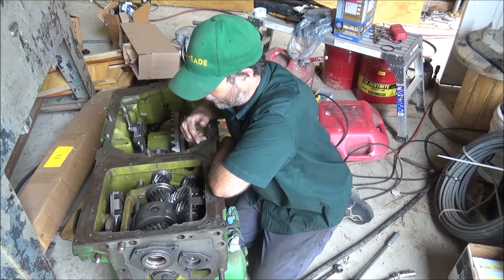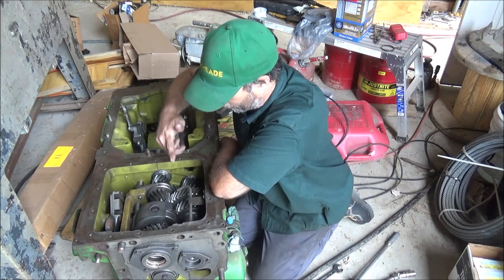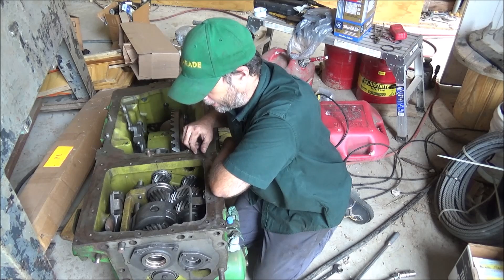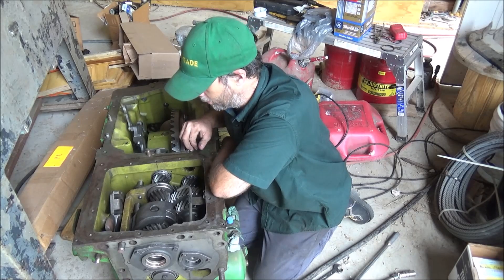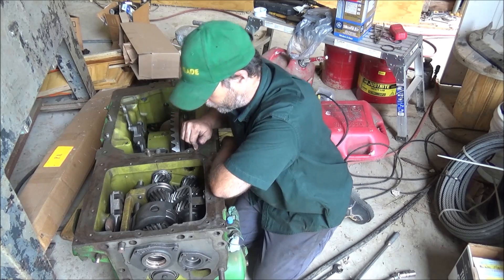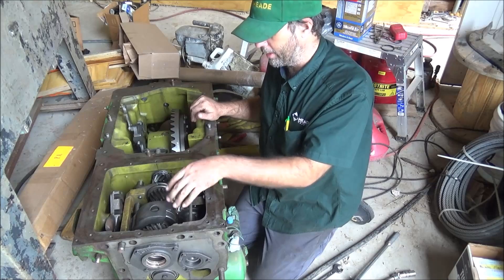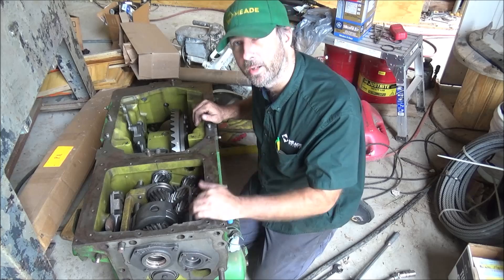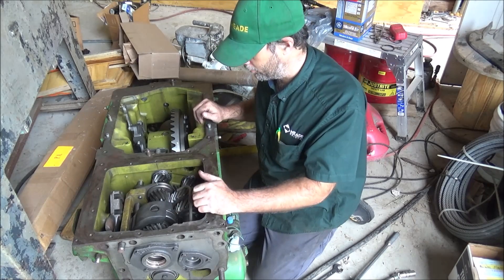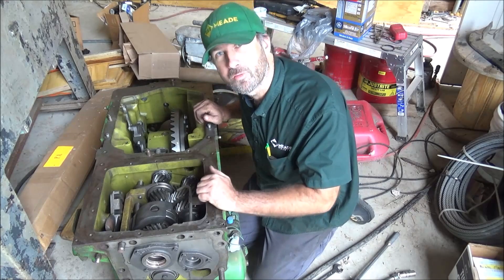Because this took so long, apparently I erased or wrote over some of the original footage of me starting this job. The counter shaft — which is the first piece you put in — I know there's no footage on that, and I don't have any footage on the bottom shaft going in either, because there wasn't any room for the camera with me cussing and putting that thing in. That's probably the biggest pain in this whole job — getting everything in down there, because it all has to go into the case and then the pinion gets stuck through it, so there's like 10 pieces that all have to stay in line. Not an easy job, but this one's done. Hopefully they'll be more conservative and not tear it up again. If they do, maybe they'll pay me to build them an entire transmission that'll actually survive more than 800 horsepower. Thanks for watching, thanks for subscribing — I'll catch y'all later.